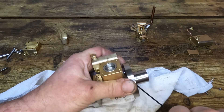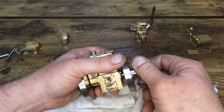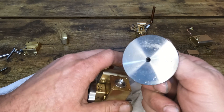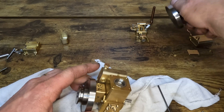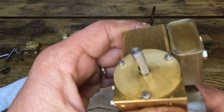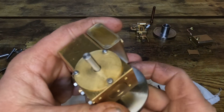Alright, let's pull our flywheel off here. We'll have to be mindful of where this was set at — they did cut a flat spot in the shaft for us, that's nice. Right here is our magnet for our inductive pickup, so that'll help with setting the timing. You can see an oil film right here by moving the crank — it does have excessive play in it.